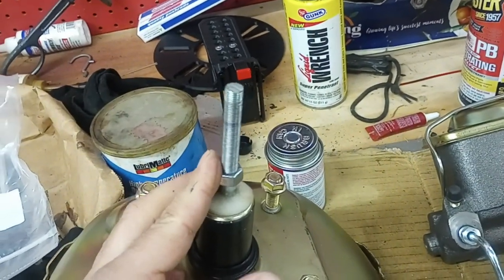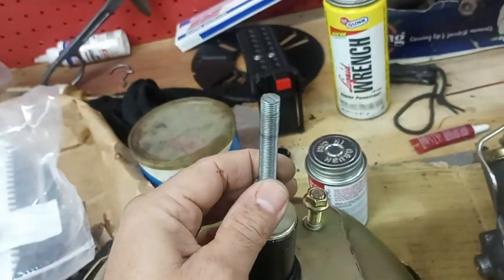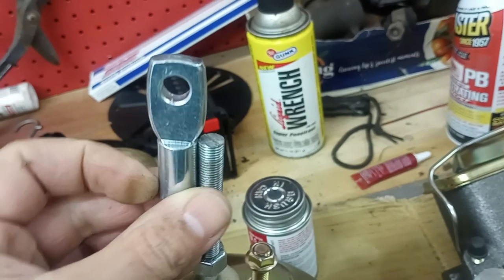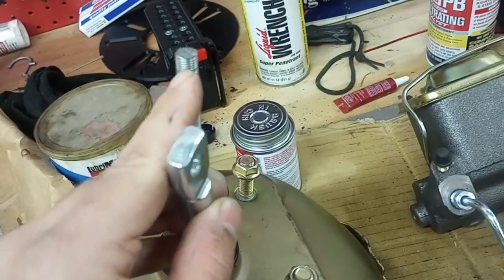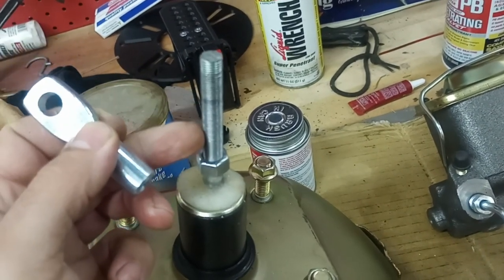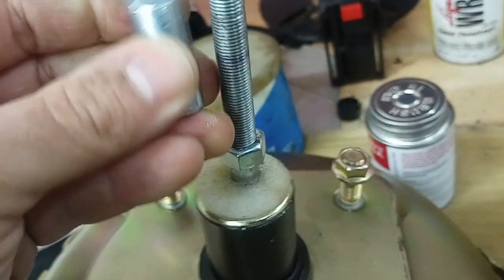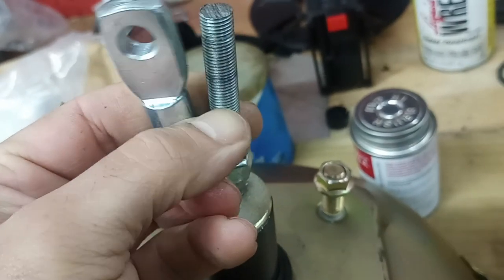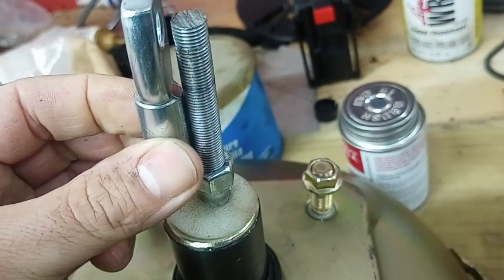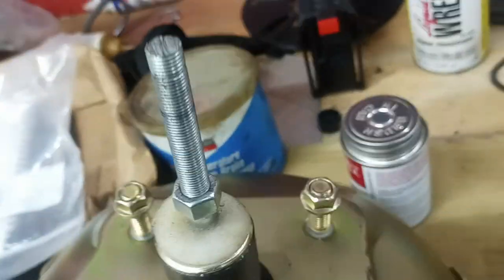Back to the workbench. The other customization is I have to cut this rod back. I've already cut it — it was originally maybe about that long. I cut it down so I could at least get it through the hole. And now this is the clevis that goes on that attaches to the brake pedal. The hole needs to be right about where the end of the rod is, which means I had to add threads. So I tapped it all the way down to the bottom — I think it only went to here before. Now I can thread this all the way down and then I have to cut off somewhere about here again. So then I'll have room to go down, go back up, make my adjustments. That wasn't too hard to cut off, but yeah, it fits — it fits a Wildcat.